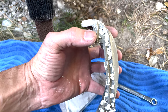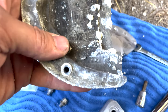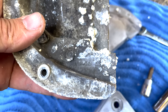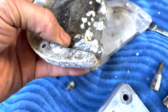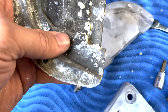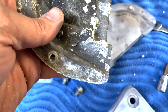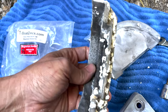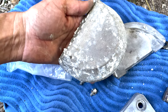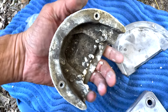I actually found a part number on it - 984513 - and I looked it up and it comes up as zinc. Apparently if it has an 'M' afterwards that would designate it as magnesium, or probably 'A' for aluminum. But as an OEM part from Volvo at the time, this is definitely going to be zinc - definitely the wrong type of anode.